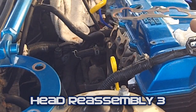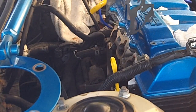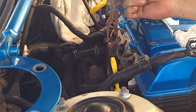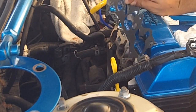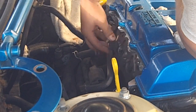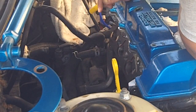Before we put the intake manifold back on, we want to put our intake gasket on. This is just a fiberboard, same thing as your throttle body or your IAC. Originally it did come with a metal gasket, but I want to swap that out with this. These will not last as long as a metal gasket, but it also has less potential for damage. Install the side with the adhesive down — you want that to contact the intake manifold and seal up against that side.